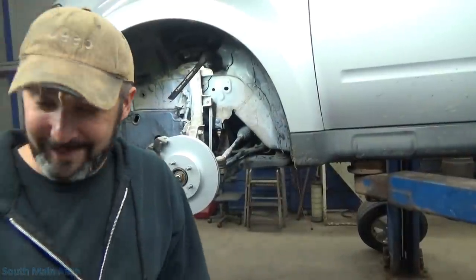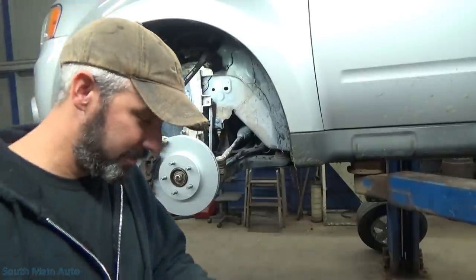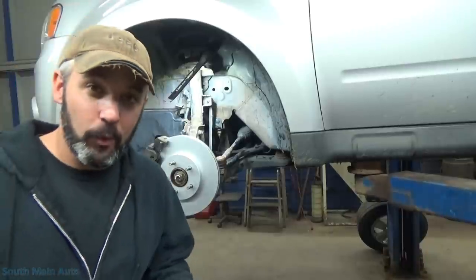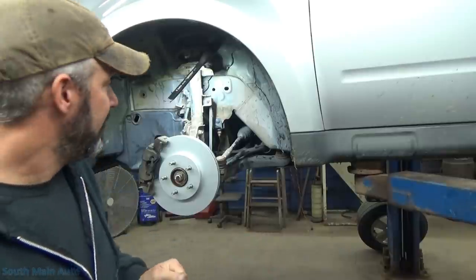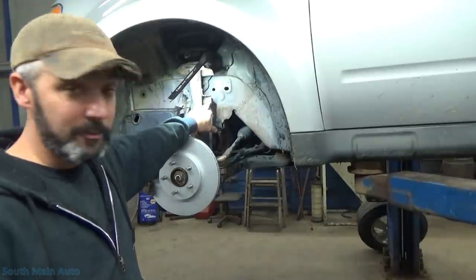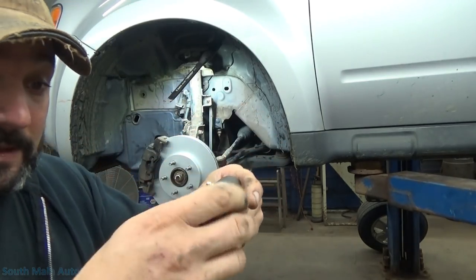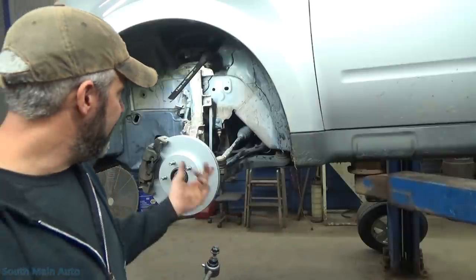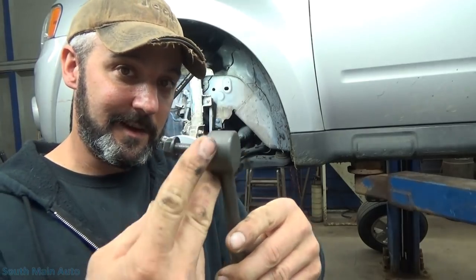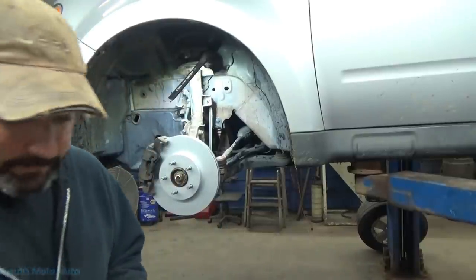So that's pretty much it. This is the first generalized video I've ever done. Probably most people know this, but I feel that I owe it to you to change the sway bar links. Typically they're pretty easy, but sometimes in New York they suck - you take them off with a torch, they can be a real pain. On the factory one here, there's a spot where you hold it with an Allen key, then you take off the nut - same thing on the bottom. But more often than not, it's just one big clumpy mess of rust. The aftermarket ones actually have a flat on the inside so you can stick a wrench there with a socket on the outside. We'll spray them down with some penetrant and get them out of there.